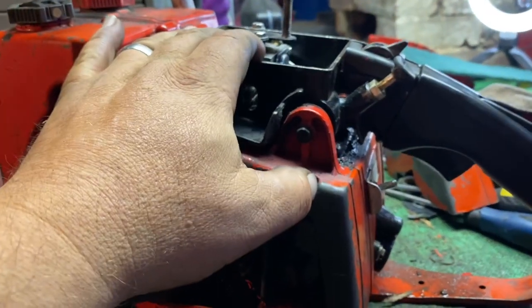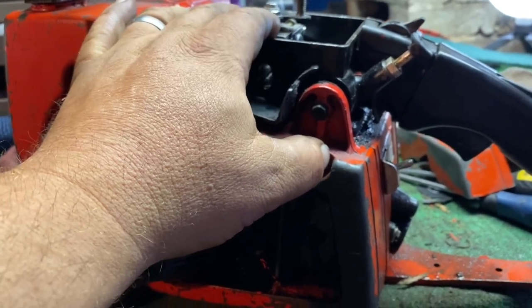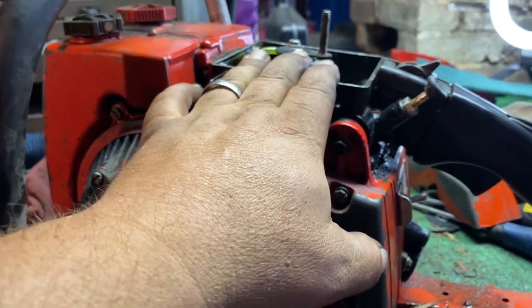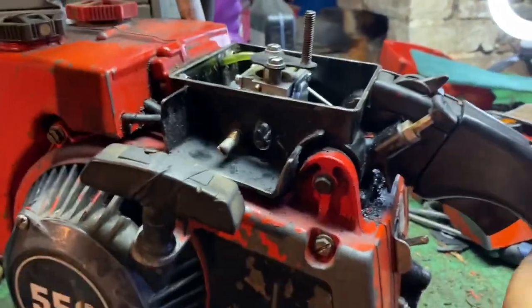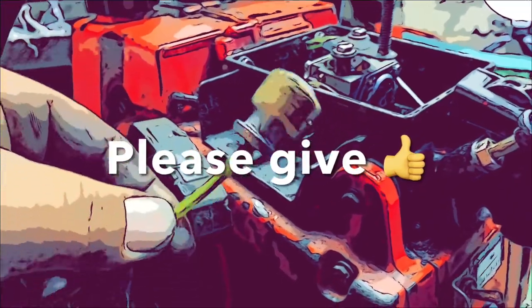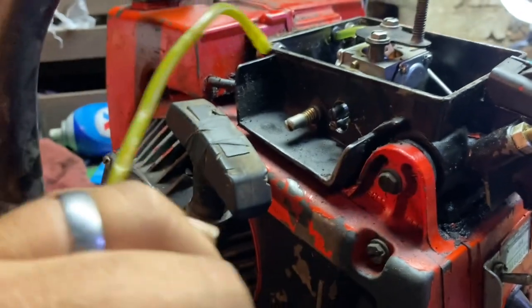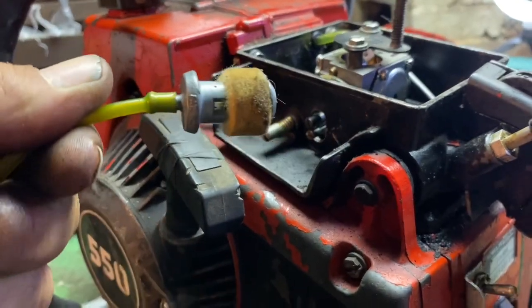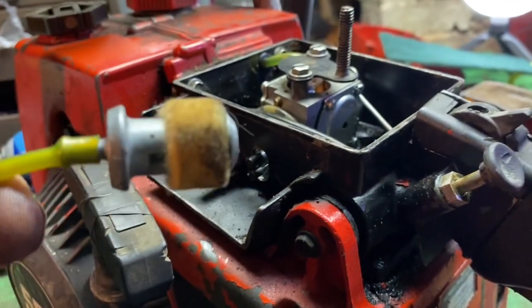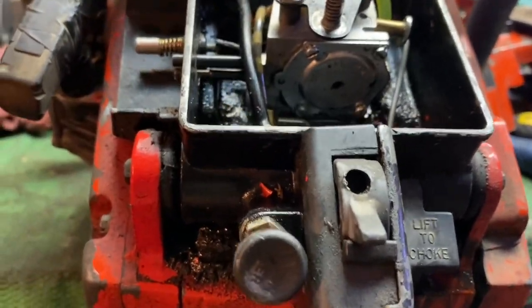I do have another intake boot and I'll probably throw it on when I tear it down, just to be on the safe side. The work I had to do to get it running was really just in the fuel system. She was all stuffed full of the nastiest stuff you can imagine. Here's the old fuel filter — you can imagine what got sucked up into this thing. The fuel line is hard like plastic. Every little nook and cranny in that carburetor was stuffed full of junk, but I got it cleaned out and she does run fine now, except for all the issues.